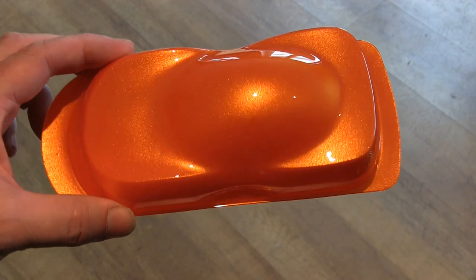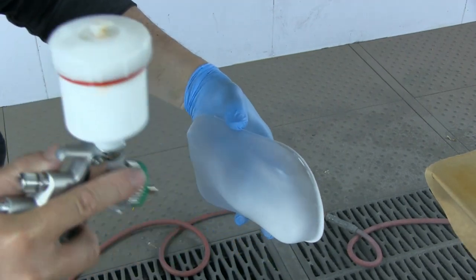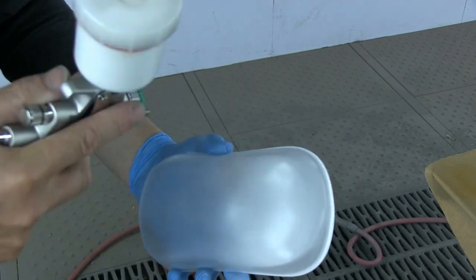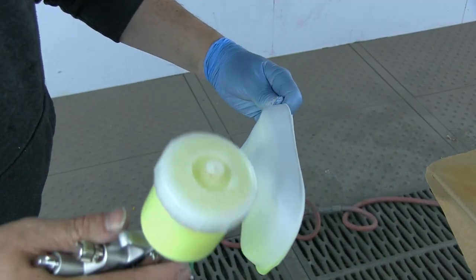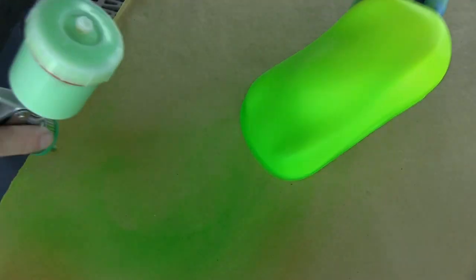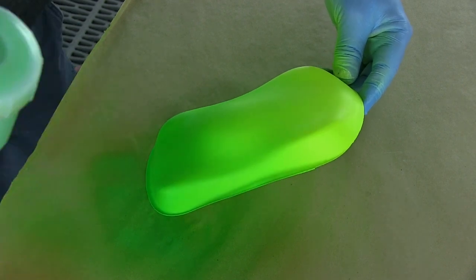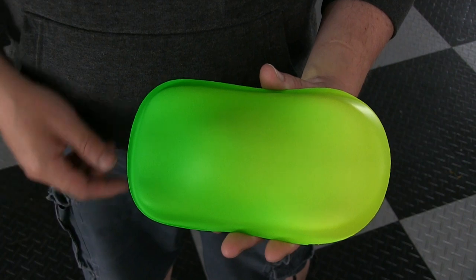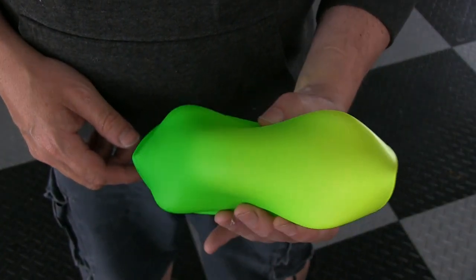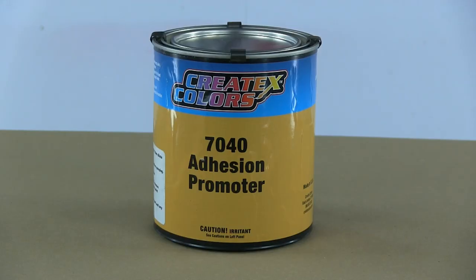You can see this color a little bit better in the light here. Now I'm going to paint the outside of a shell - I've used a particularly nasty piece of Lexan, probably the flimsiest shell I've ever used. The principle is exactly the same: chemically clean with alcohol, worn red Scotch-Brite, then come in with Auto Borne Sealer white for the initial bond, followed by fluorescent yellow, and chasing a little bit of fluorescent green into that yellow. I've painted over five or six hundred Lexan speed shapes for various shows in the US and Europe - I've had them damaged in transit, even break and smash, but I've never had the paint fail once.